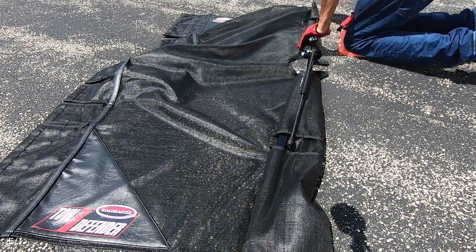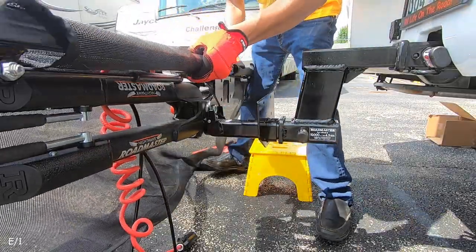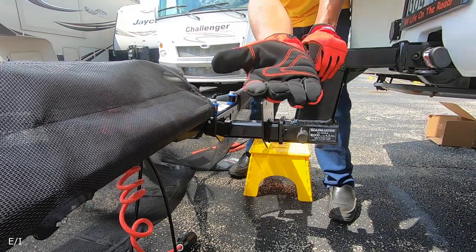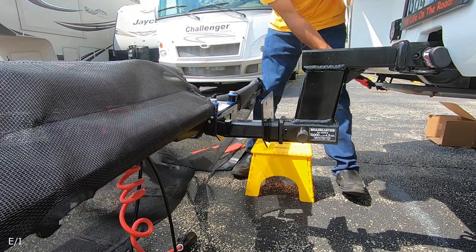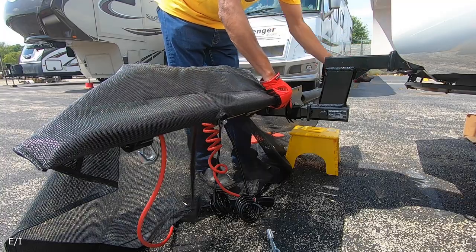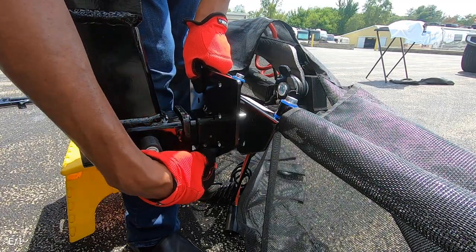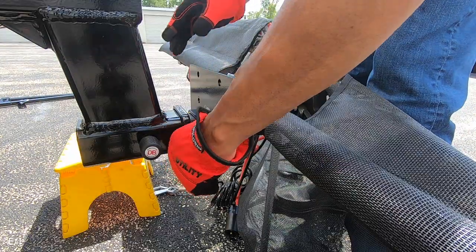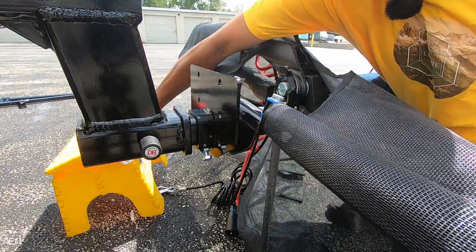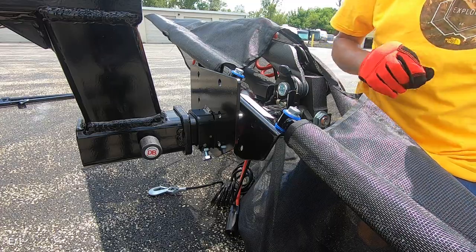Now I'll take my collar bracket — remember earlier you have your high, medium, and low connectors. You want this to be basically even with the bottom of the bumper. I'm going to put it on the top/high setting because if I put it too low, rocks can come up underneath. I'm going to put it on the high setting and hand tighten the collar bracket — you don't want it too tight because we want to be able to adjust it. Once the collar bracket is hand tightened, we'll fully tighten it down once we get everything set up. I'm going to use a 3/8 bolt and put it on the high setting, then do the passenger side as well.